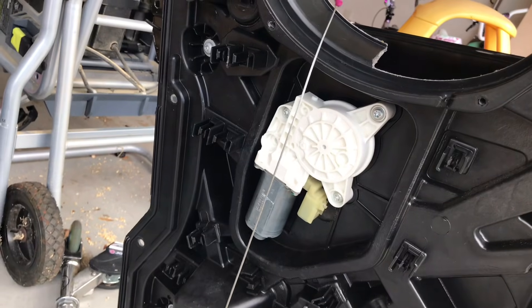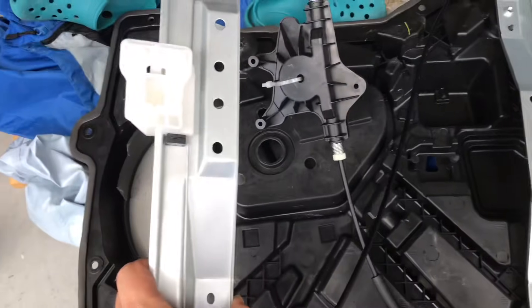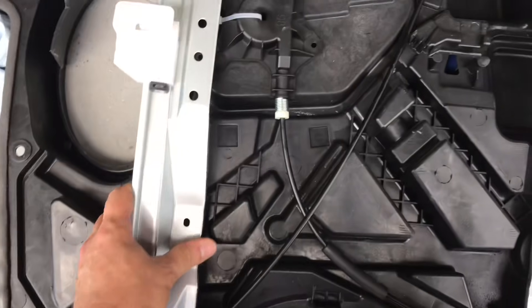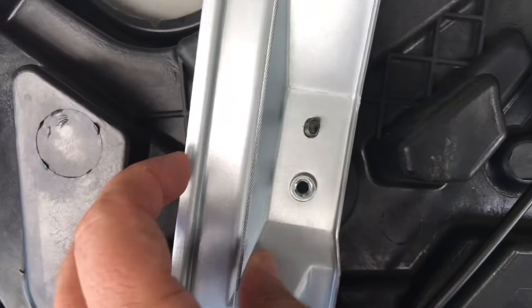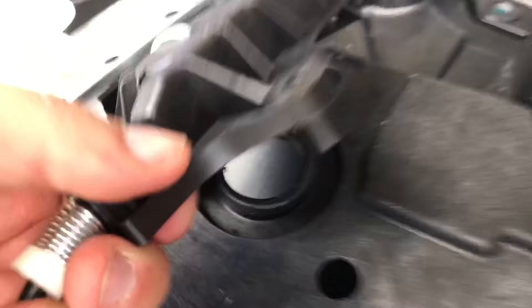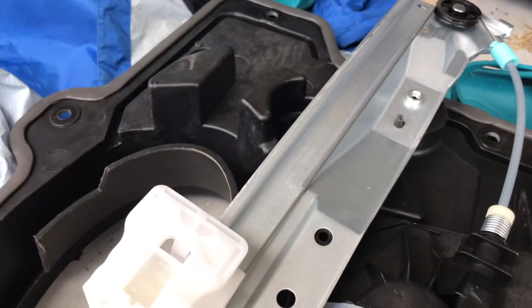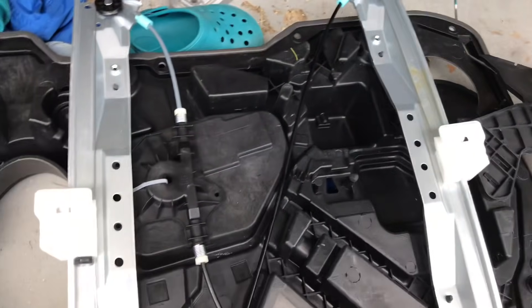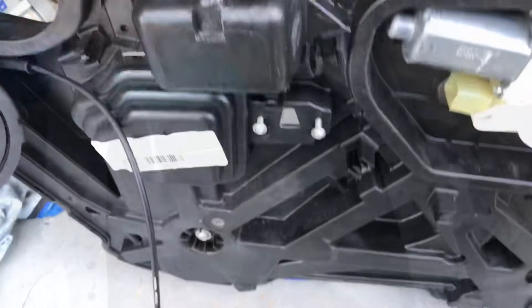The tricky part is getting the motor back in if you've never done this before. It twists into a little X pattern, and if you bought the right model that matches up, it clicks right in — there's a little guide hole to get it in just the right spot. There are three little pieces where the motor attaches that go right into the three corresponding holes, so it should fit together just like a puzzle. If it doesn't, don't force it — you may have the wrong one. In my case it looks like I did get the right one.